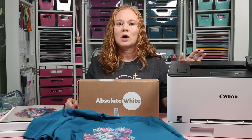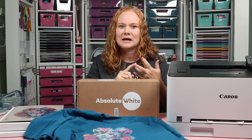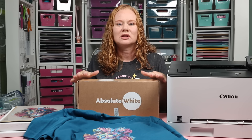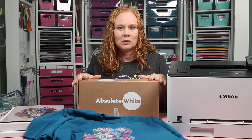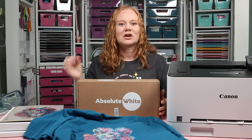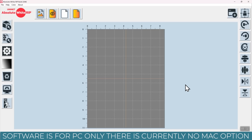You probably already have your printer set up. Follow all instructions for setting your printer up that come with it. You want to get the printer completely set up with the cartridges that come with it — it probably comes with CMYK: cyan, magenta, yellow, and black. You want to set it up with those cartridges installed. Then open your Absolute White cartridge and there will be a key on the inside. Go to the website, download the RIP software and use that key to activate it. Once you have that RIP software installed, we are ready to take an image and convert it into something that can be printed with this Absolute White toner cartridge.